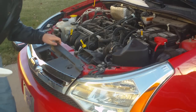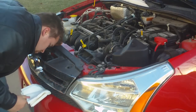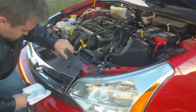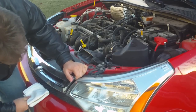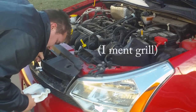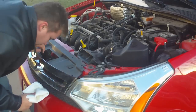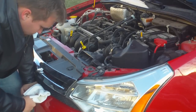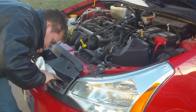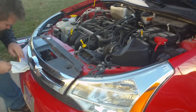The reason for this is because you're going to end up prying the bottom of the grill off the top of the bumper. The way the grill attaches to the car on the bottom is that there are four little U-like slots the grill slides into, coming up from the bottom of the bumper, and there are two clips attached to the grill itself that clip down over the bumper. To remove the grill, you've got to push the bumper down and pull the grill up so the clip goes up and over the bumper. Get something to pry under there, push the bumper down, pull the grill up — it'll pop right off. You want the padding so you don't scratch your paint job.